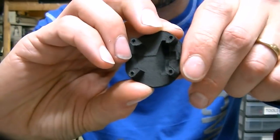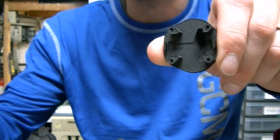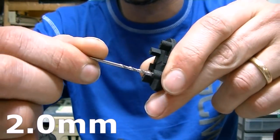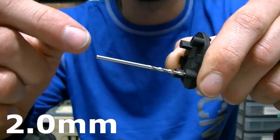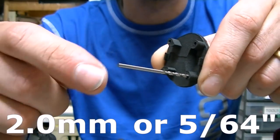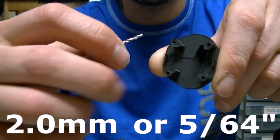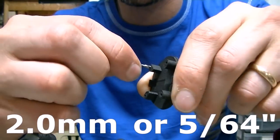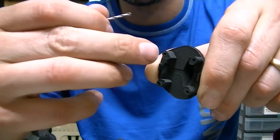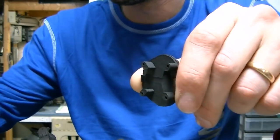Now, the covers. On a GCM axle, the cover bolts are M2.5, so you actually need a smaller drill — a 2mm drill, which is also 5/64 inch size. So 2mm for the covers, or 5/64. Then the cover screws will have the proper holes already in it. Same story there: get all the dust cleared out of the cover holes so that when you put the screw in, there's nothing inhibiting the screw from going all the way down into the hole. Very important.